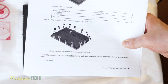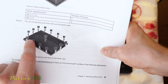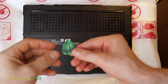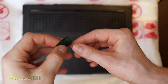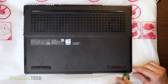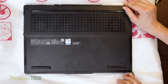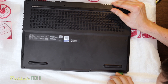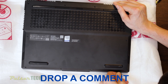According to the service manual, there are multiple latches on each side — four in the front, four in the back, three on each side, and one in the middle — so you've got to be careful not to break them. To pry it up, I usually use a guitar pick; you can buy them in any cell phone repair kit. They're pretty thin but sturdy, so they won't bend and won't damage the laptop's material, meaning no scratches. It is a slow job, especially if you've never done it. Don't pry too fast because it might break some latches. Take your time, slowly find those latches, and slowly pry them up.